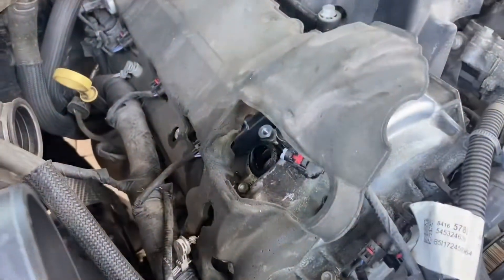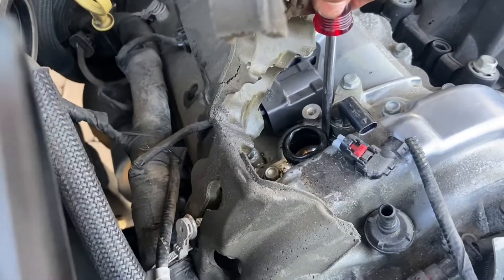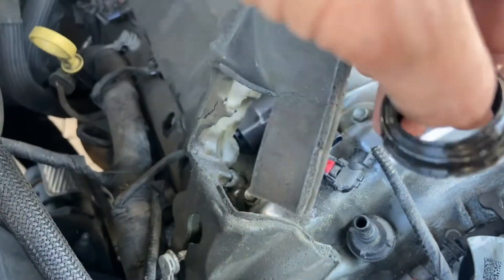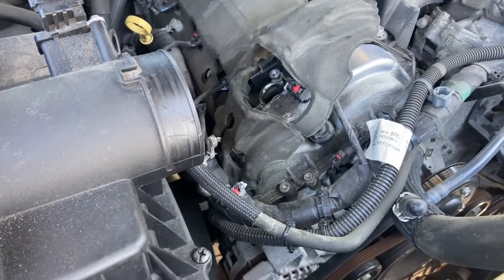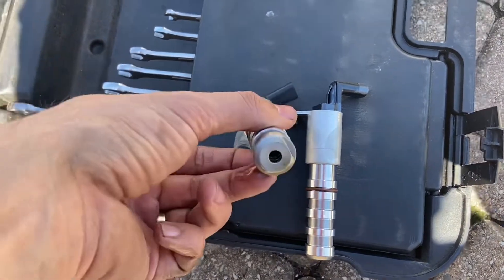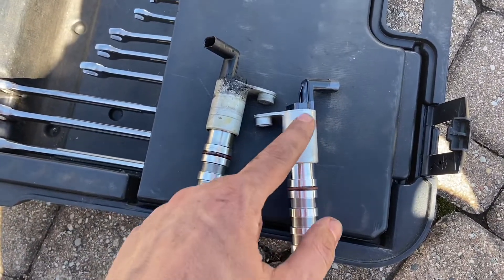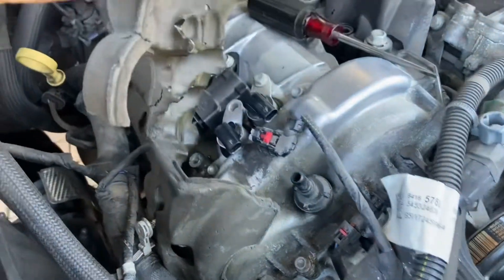Getting the gasket out is actually pretty simple — I was making it more difficult than it was. I put my screwdriver in here and used leverage off the adjacent piece to pry it right out. You should replace it: take some clean engine oil, get it wet around the ring so it slides in and helps seal it better. Here's the new one versus the old one — you can tell by the oil on the old seal. Put a little bit of oil on the shaft as well to help with sealing, then slider it in — the new one slid right in easy.